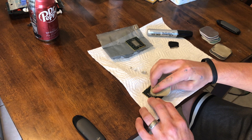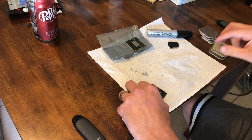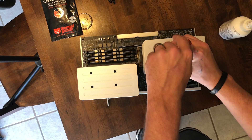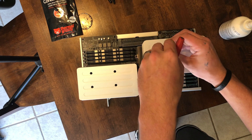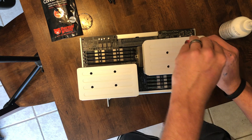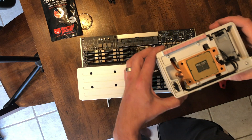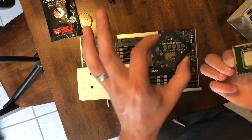With our CPUs all polished up and ready to go, it's time to remove the old CPUs and do our install. The only tool needed to remove the CPU heatsink is a 3mm allen key. Start by undoing all four screws in one heatsink in an X pattern and then gently lift straight up on the CPU heatsink. In all likelihood, held on by thermal paste and with no retention mechanism to keep them in place, the CPU and black plastic spacer will come up with the heatsink.